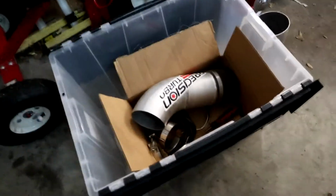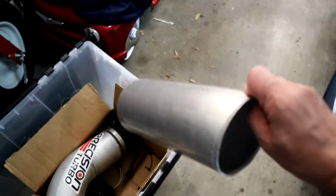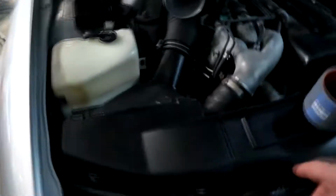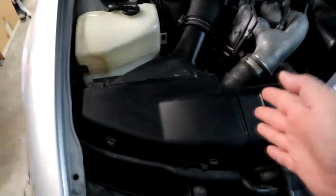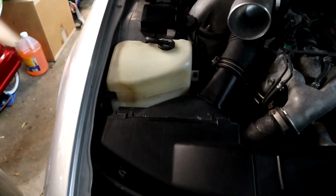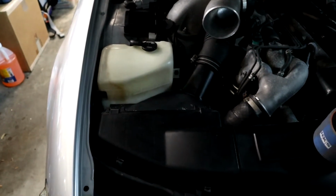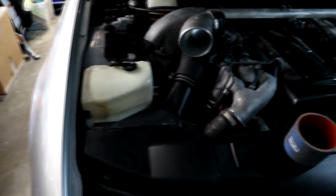And this right here was actually off of the drift car back when it had a precision turbo. But I brought home a couple things to build an intake for it. I'm probably going to do that. It's going to be really simple, but eventually I'm going to leave this piece because it does draw fresh air from the grill. And I will end up making a heat barrier thing. Not that it matters that much, but it can't hurt to block some of the hot air going into the turbos because they create a lot of heat on their own.